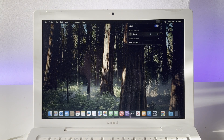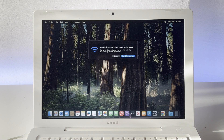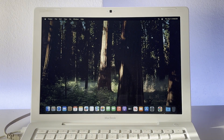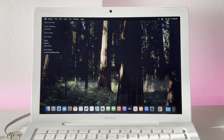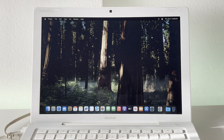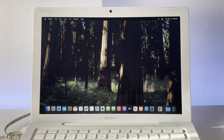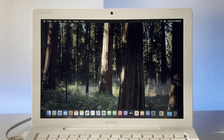I still can't seem to connect to the network. I'm not sure if there is an issue with my network, but all other devices work fine. It just says the Wi-Fi network could not be joined. So I guess we are back on Ethernet. Installing that root patch in theory should solve the Wi-Fi issue and your Wi-Fi should work absolutely normally. If you guys know anything about that, leave it in the comments because I would like to get Wi-Fi to work. But for now, Ethernet will be just fine. I'll just test out how web browsing is on this machine.